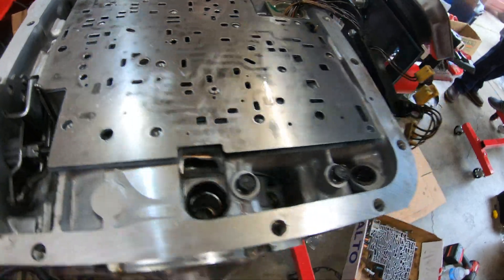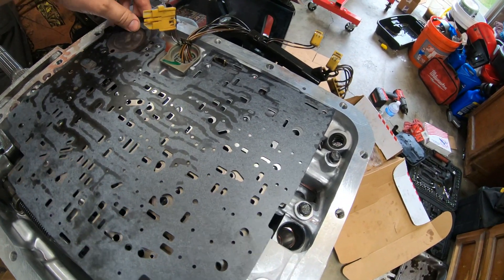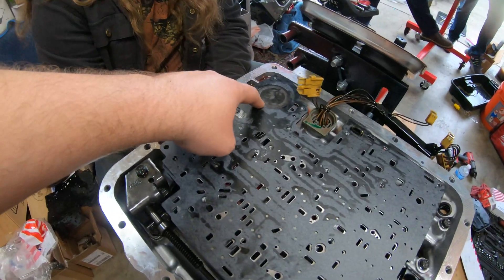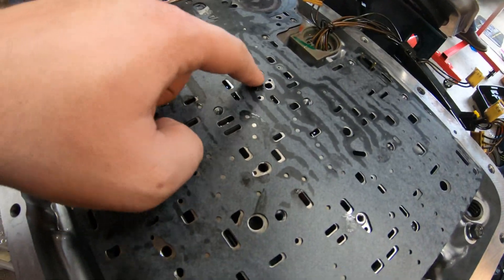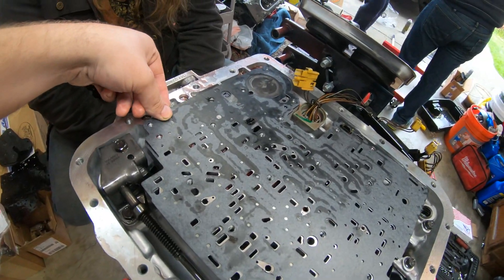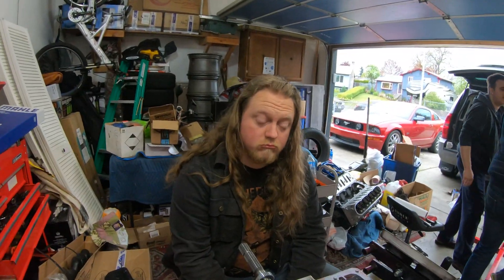These also have VB and CA marked on them — CA stands for case, that goes towards the case; VB stands for valve body. So this is all ready to go on. We're going to line this up, get the accumulator on right here, and then get the actual valve body in and the check balls in. They just go in the holes — I took a photo of where they go. There are seven total in our application, maybe not yours. The Corvette has six, just a little tidbit. We're going to go ahead and line this up, get the valve body on, and be finally done.